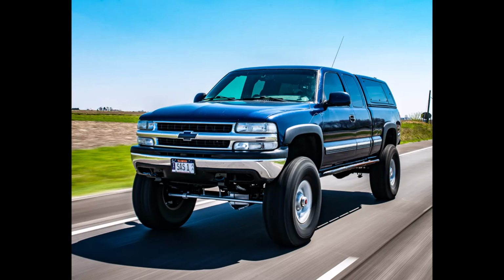Growy was there on his solid axle swap, Maroon '03 or '04. I got there, put it in front-wheel drive to do a front dig just to play around, and I broke the double cardan because this was really stupid. I broke the centering stud pressing the U-joints in on the press, which is why I don't use a press anymore to do U-joints.